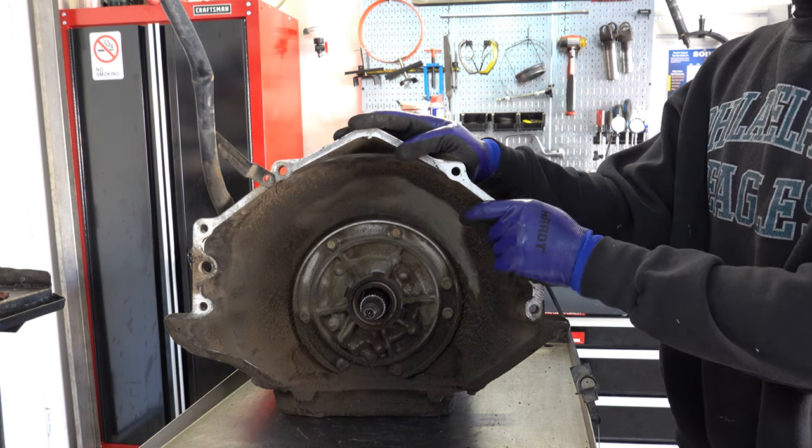Forward piston housing. If you have a forward burn-up, another likely cause is a cracked forward piston, very common, or at least relatively common with these transmissions. And same with the '93 to '96 4L60Es. On reassembly, when you do your air check, you're going to want to pay attention to any real faint hissing sound that comes from deep inside the drum. That hissing sound is going to be the air blowing by the seal here for the forward piston. And this applies to aluminum pistons or bonded pistons.